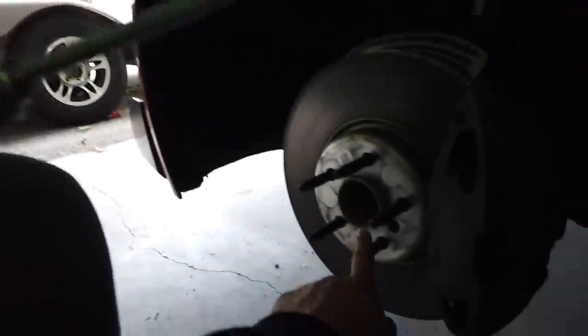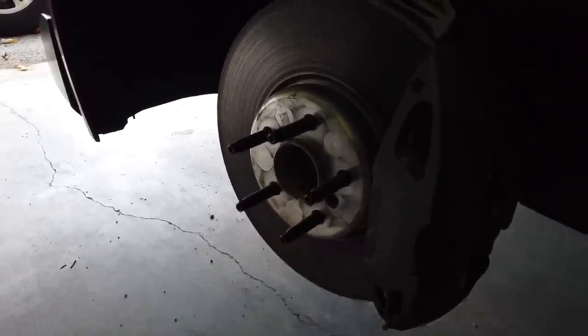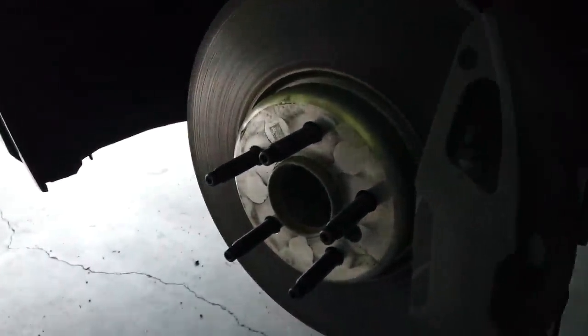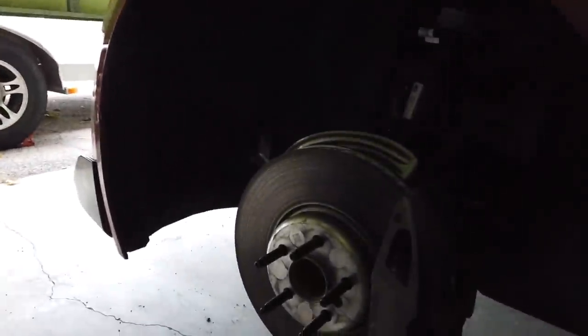It's actually torques — we need to get some better torque wrenches to make sure when we torque these new stud conversions from Motorsport Hardware, we don't break the six-point Allen heads. We have to put like over 100 foot-pounds of torque on it, and a regular Allen key is not going to hold that much torque. So we need to find one that's either strong enough, or has a lifetime warranty so if we do break it we get new ones.